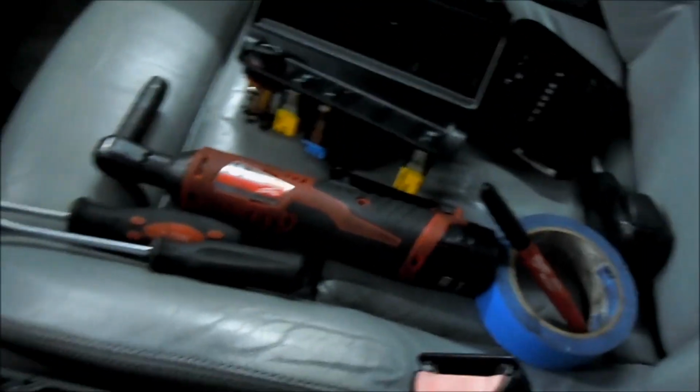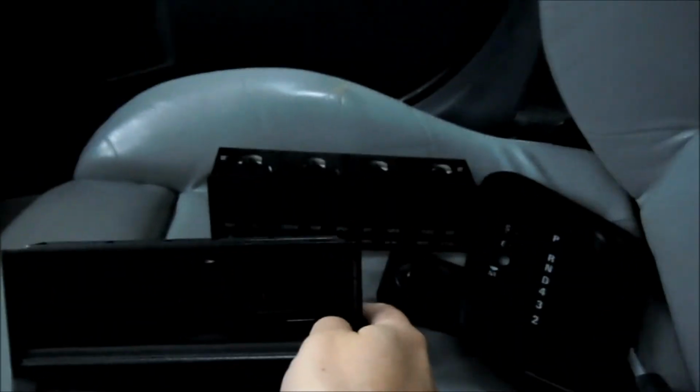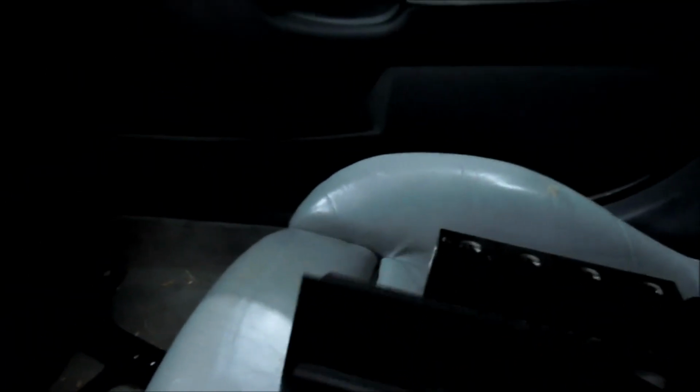Alright, I've gotten a bit carried away in just diving into this whole thing, but I figured I'd give a little update of what we're working with inside. So I started dismantling the auto console. Basically, this is in here with the onboard computer. You just yank those out. They're just clips, and you unplug everything underneath. Then the whole shifter surround comes out.